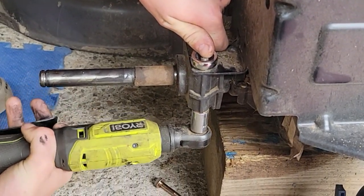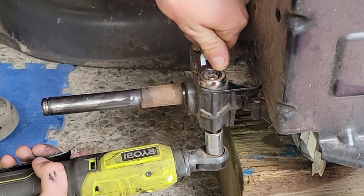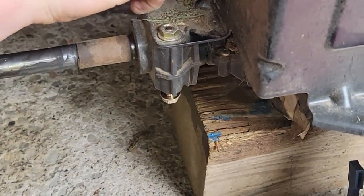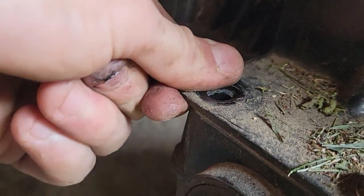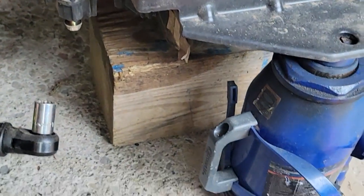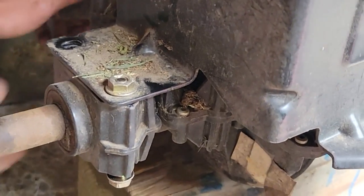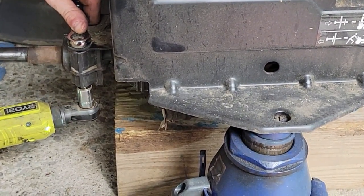Now the last bolt — wait, the last one might let the transmission drop so get ready for movement. Stop at the end, don't take it all the way off. Wiggle that tranny up and down, see if it's loose. Grab the front end — does it tilt down? Let me jack this up a little bit. Now tilt it down — the front goes down on its own, okay we're in good shape. I was being safe with the jack and block holding it, so let me let this down again.